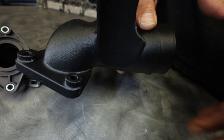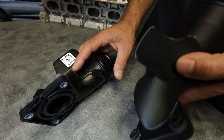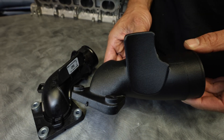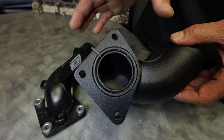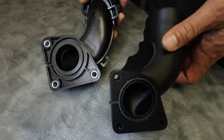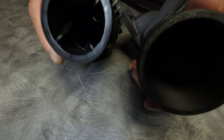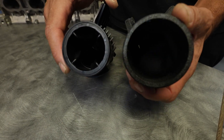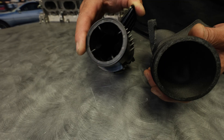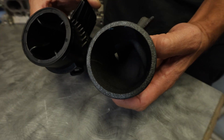This is the Full Race prototype part. What we've done is optimized the factory part in every way to make it a complete bolt-on. The bolt patterns are the same, the gasket here is the same, we retained a little heat shield for the electronic wastegate, and we gave it ample clearance here for the EGR component tree — that's not found on the other 3.0 Bronco or the Raptor, but it is on the 2.7, so we had to make some real accommodations to get the 2.7 intake to flow like the 3.0 — actually better than the 3.0. The reason is Garrett released their PowerMax turbos for the platform, the 2.7 and the 3.0, and we're seeing that on the 2.7 this little hole compared to the Garrett size, and then compared to an aftermarket intake size, they're going to be the restricting difference. The passenger side turbo with an aftermarket intake can be flowing great once you put the Garrett turbos on, but the driver's side is going to choke up.